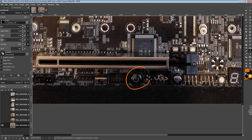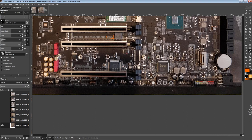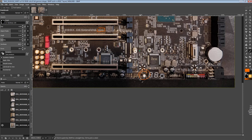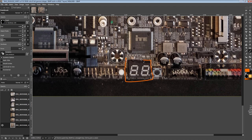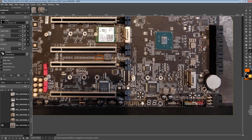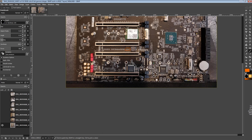There's also a power button in the least convenient location possible — put a sound card in and you're not going to be able to press it. It depends on the card: some fully take up the slot, some are basically just a PCB, but with thicker PCIe cards you're not getting to press that power button. Then we have a reset button and a CMOS switch for clear CMOS. In between we have the postcode display, but it's in the location most likely to get covered up by a GPU — a three-slot card could end up covering it pretty well.